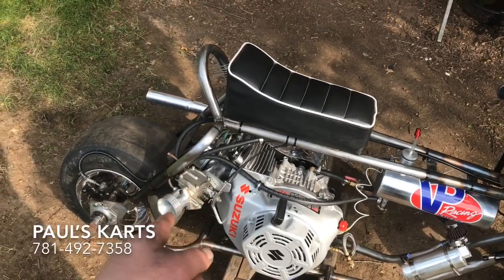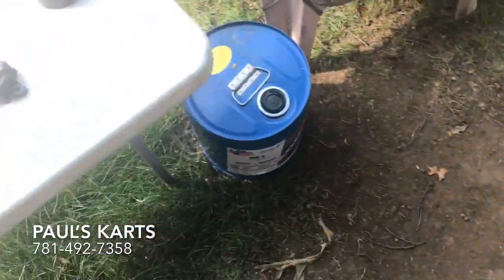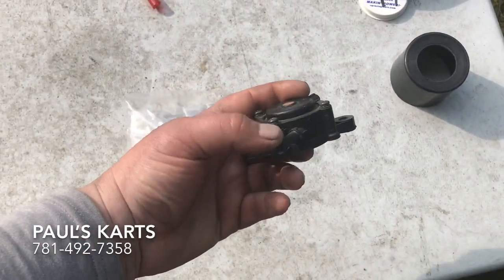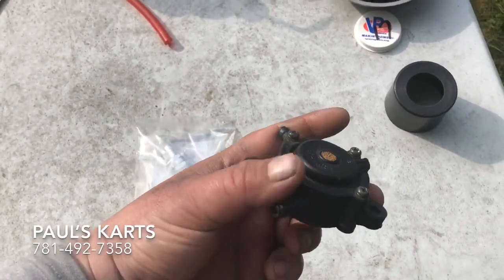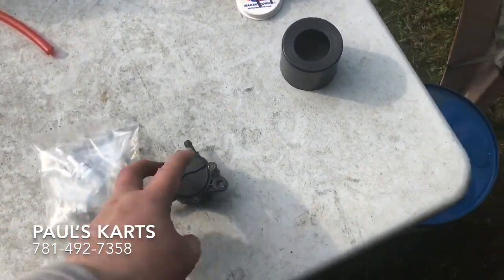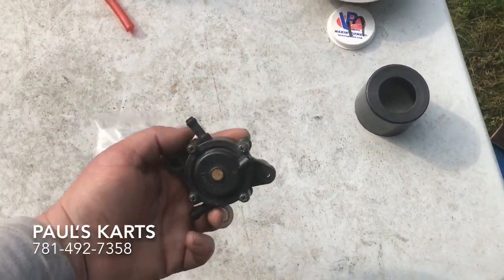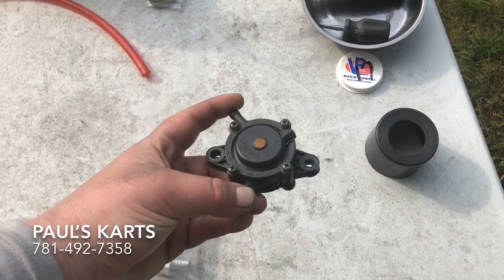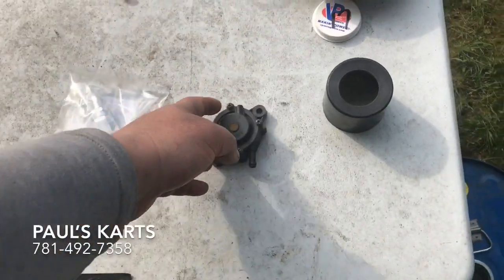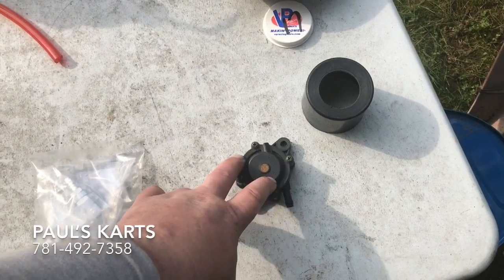So this has the answer to everything. You take this pump, block it off, and I'll show you the fix right now. Turn around behind me — and here it is. I'm just kidding. Isn't this fuel pump adorable? This is the fuel pump that most people have for like a Predator 212 — this is like that seven-dollar eBay piece of crap, Amazon garbage. This thing is probably all right for gas on a small block, but if you still had gravity fed — these things are kind of useless. This type of situation is not going to work for you on a big block on methanol.